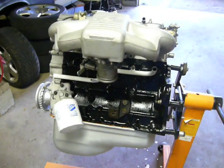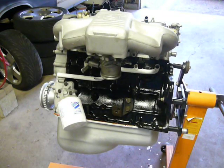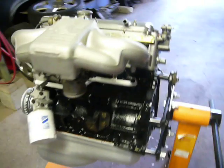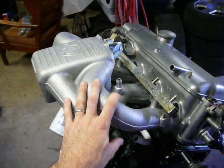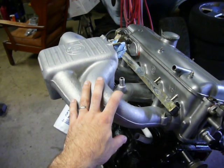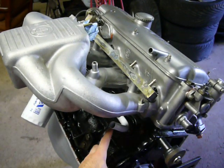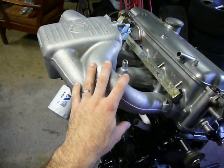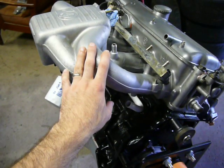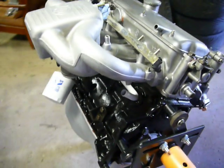So, other things to do on the list was to do some work on this. We've put quite a few items on, probably the biggest of which is the intake manifold here for the electronic fuel injection. We've got a coolant bypass pipe down here. The original manifolds have a water jacket built in — this one does not, so we have to come up with a way to bypass that feature that we took out.